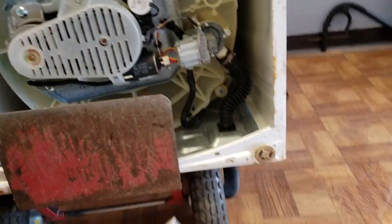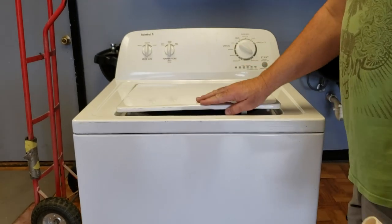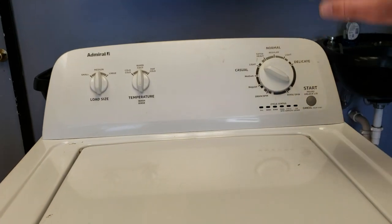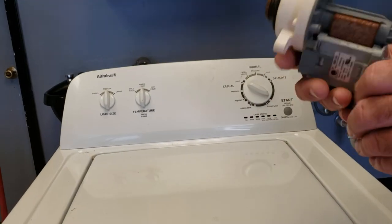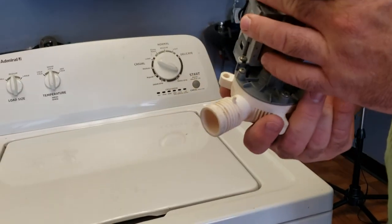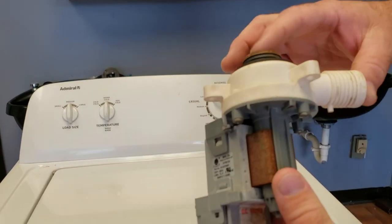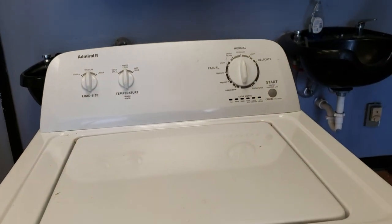You're going to be replacing the drain pump. Now I have the washer back upright. On these models, if it ever stops during one of the cycles, you should be able to push the cancel button down for three to five seconds and it cancels everything and dumps any water inside the washer out. If it's not doing that, it's probably going to be your drain pump. I'd look at the one you pull off and try to match it up with a part number. They all look almost the same for these models — two ports, one incoming, one outgoing.